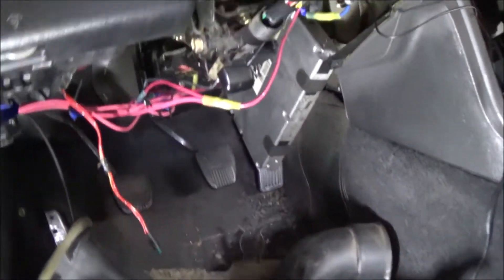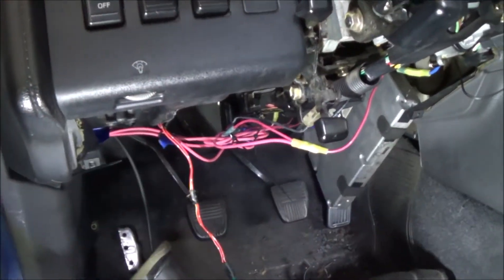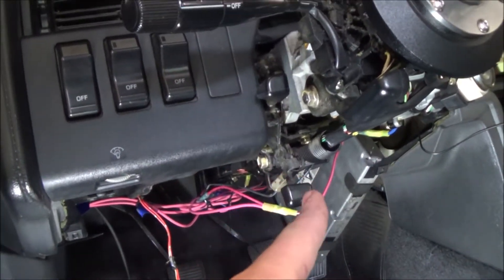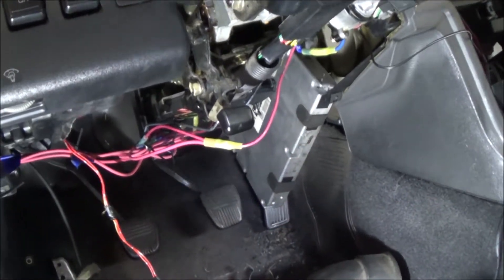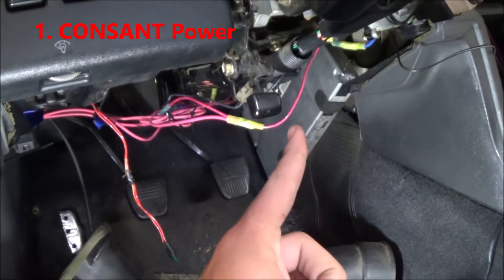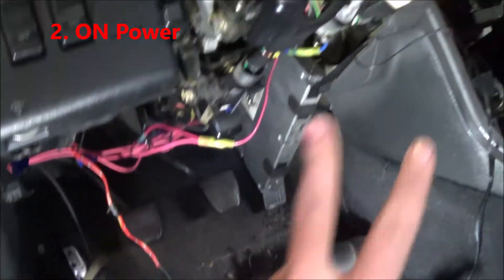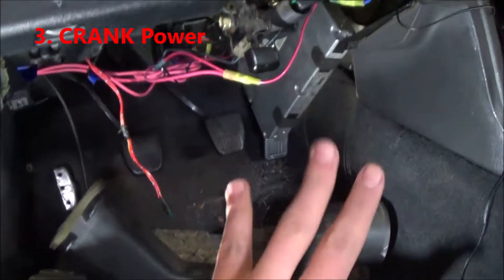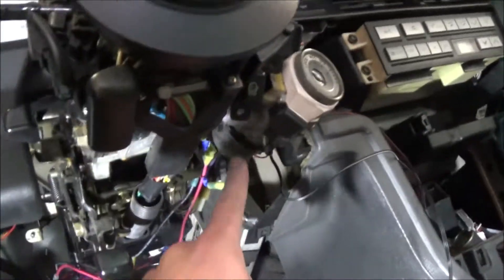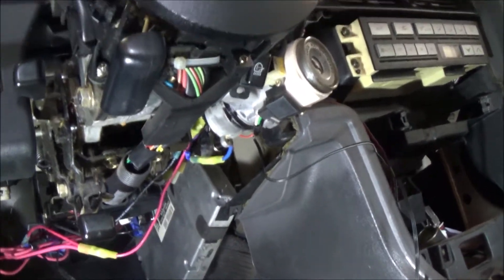I'm inside the car right now and this is where I have my ECU at the moment. It's not mounted yet — this is a little bit of a mess just because I put extra wires in that I needed, because I ran it on the outside first before I tucked it up under here by drilling a hole in the firewall for the ECU. While we're under here, I need to show you something because you need three signals to keep it simple: a constant power, which is where you put the power wire straight to the battery; an on power, which is when the key is in the on position; and then you need a crank signal for the starter.